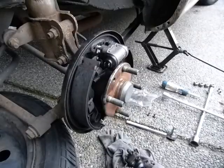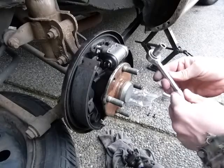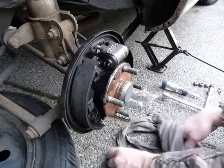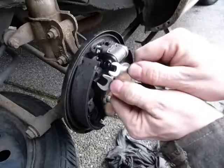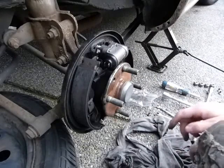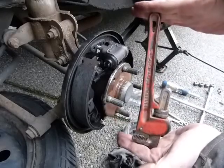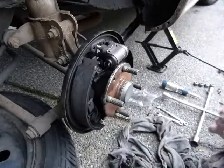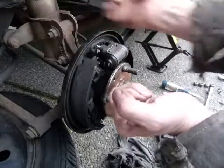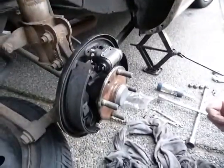And we're back to the leaky brake situation. The tools that you need for this job are fairly straightforward. You're going to need a 10mm socket and a 10mm wrench, an 8mm wrench — open end both. And that's pretty much the end of the list. You might also want to use a short pipe wrench and maybe a crescent wrench, short as well, because you have limited room here for cranking wrenches. You're going to hit the spring with a long handle real fast.